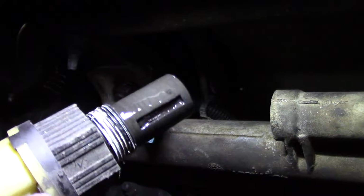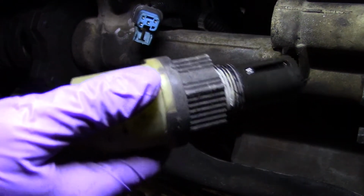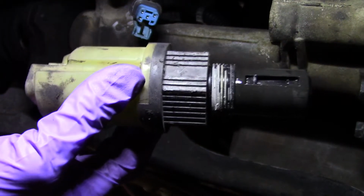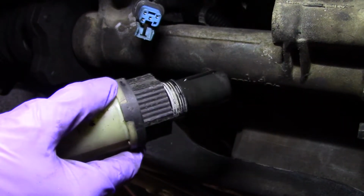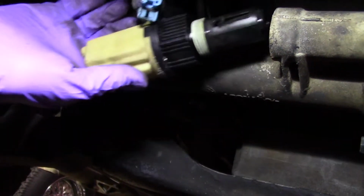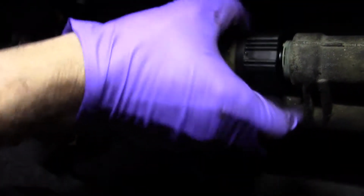Now mind you, I did not take the one, I left this side of the tube. I did have to replace the axle, and the way it actually engaged, the gears and stuff were different. The housing was the same, and I looked this up, the part number was the same from 2000 at least to 2004. I don't know what years are interchangeable, but I did look that up. So anyway, I know that this was the same. But I had to use the pieces from inside the one that was broke, because I didn't hurt the inside pieces. This is the new one. Well, the used one, but it's the one that came out of this thing originally. Anyway, long story short, I ended up reusing the guts, because the axle was different, the engager was different. So there are differences from year to year.